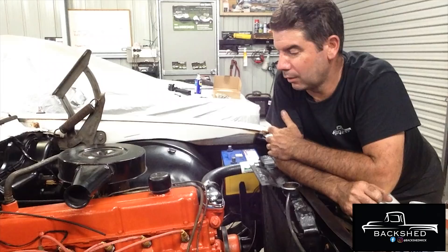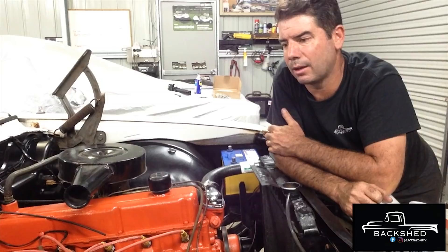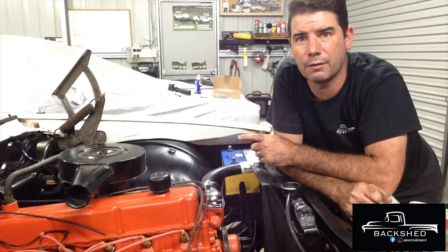Not sure of the whole story. The idea was: zip up and get it, 202 out, this one in, get back on the road. So that's been two days — out yesterday, paint the engine bay, back in today and we're almost there. I'm just waiting on an exhaust flange because I'm keeping the stock manifold. That was one of the reasons I went back with a six, and also the reason that the stock 202 will go with the car if we sell it, or I'll get it machined and put it back in later.